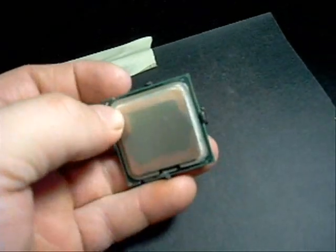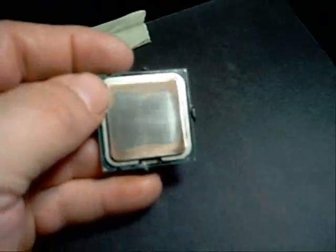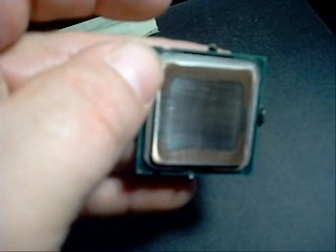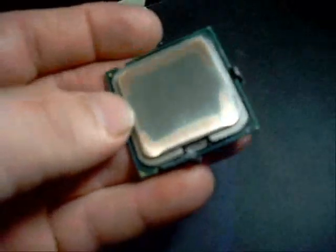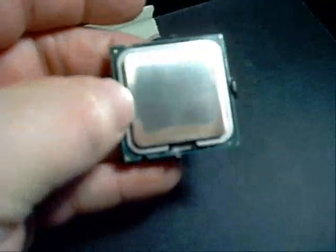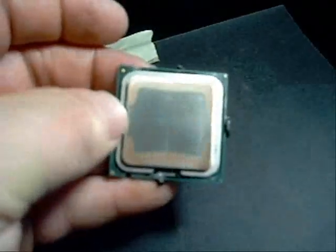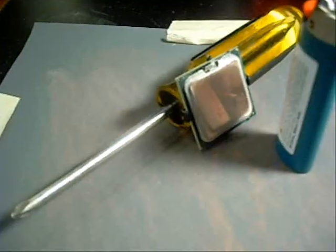You see all the copper around the edges. Pretty typical — they seem to have a high ridge all around the outside of them, with the center where the cores are kind of concaved a little. I'm not sure if that's intentional by Intel, or just something in the manufacturing process, or possibly even in the way I'm sanding. I'm trying to keep them really flat when sanding so it isn't at an angle. It seems like every one of these Intels I do always starts the same, with taking the nickel off the outside and working toward the center.